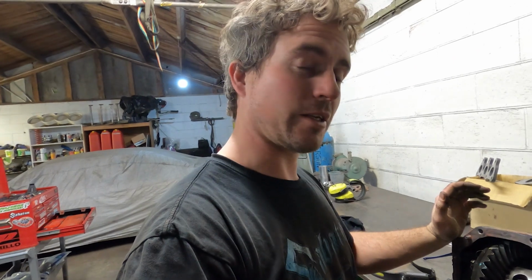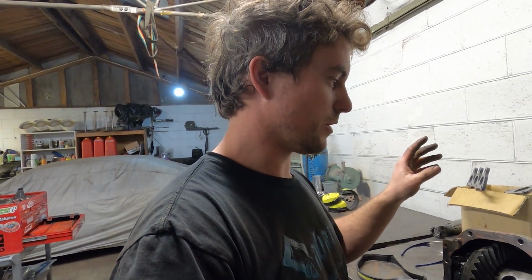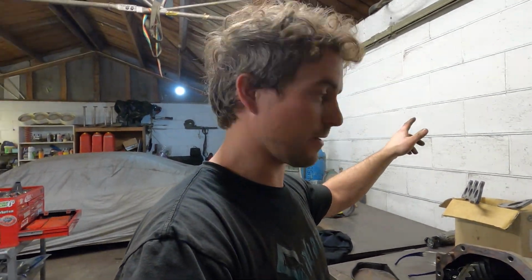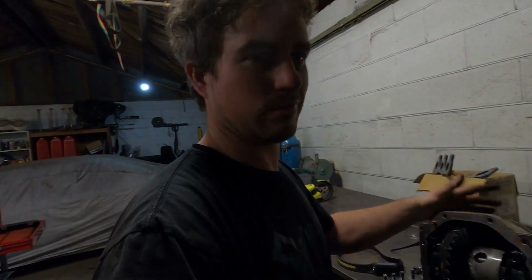And basically the other thing I forgot to mention is my other car, my first GT86 that I bought, has an open diff. It's a really early poverty spec version, and I could use an upgrade. So I'm going to put this diff into the blue car, and then take the diff out of the blue car and upgrade from that open diff to the Kaz diff, and therefore we're not pulling apart a perfectly good Torsen.